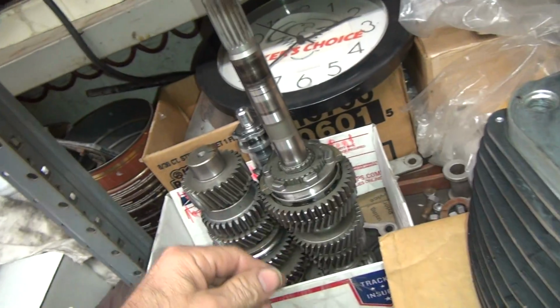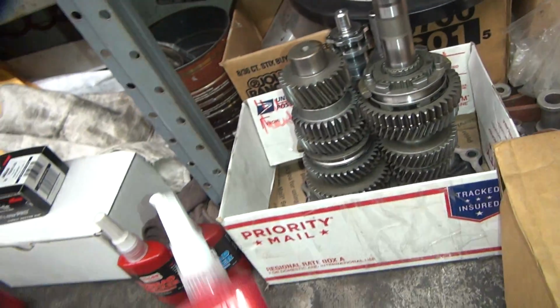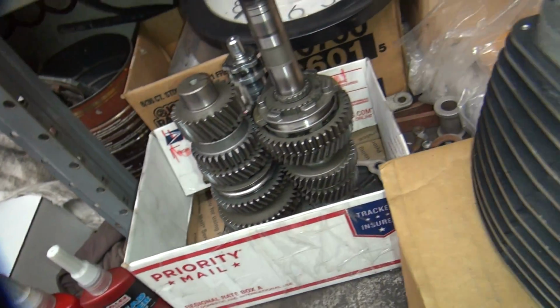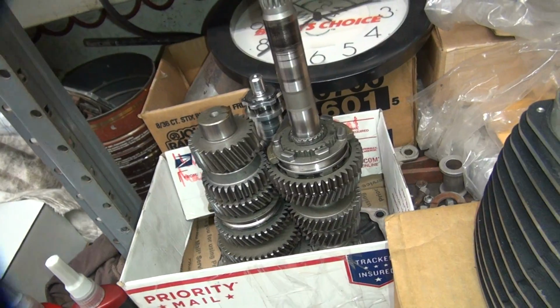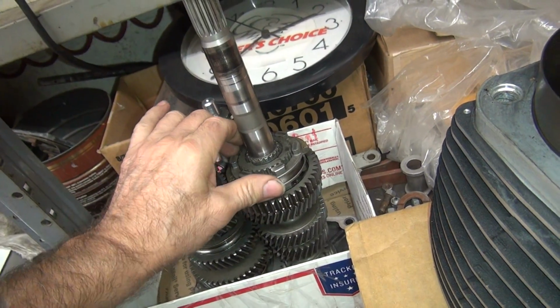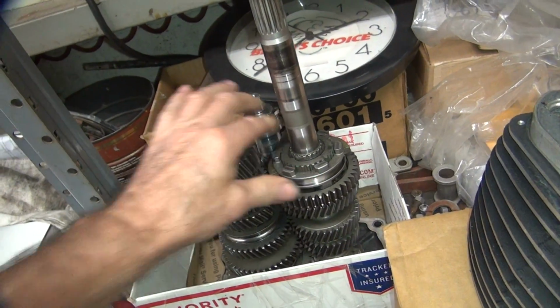You take, like, you want a sleeve that won't slide around on here. Or if you have some kind of a collar that goes on your dog that you don't want to weld anymore, you actually can use Loctite retaining compound on there, and it'll lock it together like, you know, a made piece, and it won't come apart. Well, they say it won't come apart. Me, I know it will come apart if I beat the tar out of it like I do all my stuff.